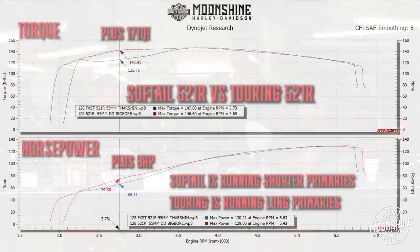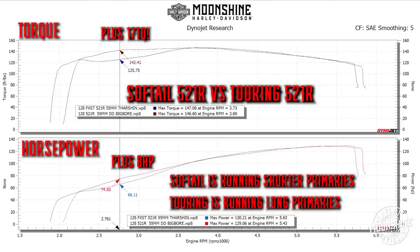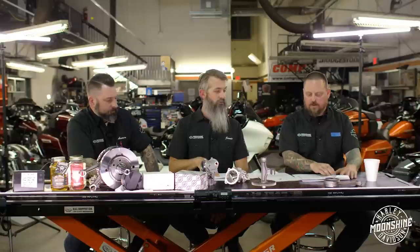You can see where the pipes merge back together - right at about 3500 RPM, once you hit that RPM, it doesn't matter that it's a little shorter because you've got enough velocity and the engine is spooled up enough. At that point it's just an air pump. It takes advantage of the decreased resistance and makes a little more power. You're at maximum efficiency, just getting air in and out as fast as possible.